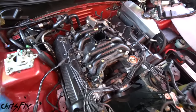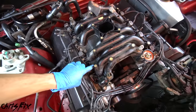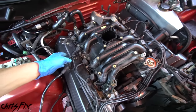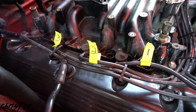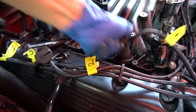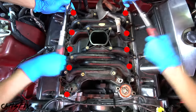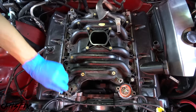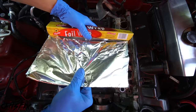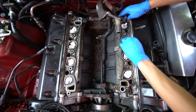With a quick inspection, everything is removed and only the intake bolts are holding it in. Before removing them, get the spark plug wires out of the way — a tip is to label each wire so you know which goes to which spark plug on reinstall. Remove the wires on both sides. Now remove all nine ten-millimeter bolts at the top of the intake. With the last bolt removed, the intake comes right out. Next, plug the intake ports — I like to use aluminum foil because you can pack it in and shape it to the contours of the ports so no dirt falls into the head.